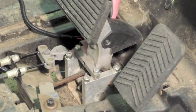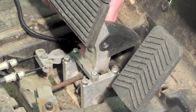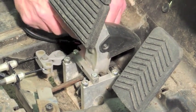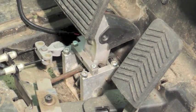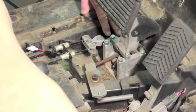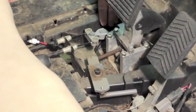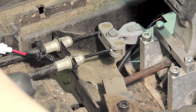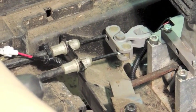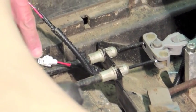Take your 6mm bolt and tighten that down. You want to make sure they're snug and secure. This is your brake system, so you don't want to leave it loose — but don't go crazy, just snug it tight. We now have our brake switch installed, adjusted, and tightened up. We're going to fish the wires through the small hole in the pedal box here, making sure it's free and clear of the linkage and mechanism so it's not pinching anything. We're going to run this up along and through right next to the brake switch wires on the LGT699.